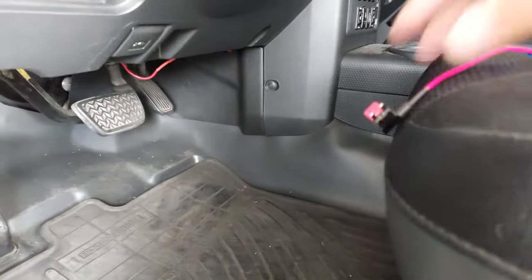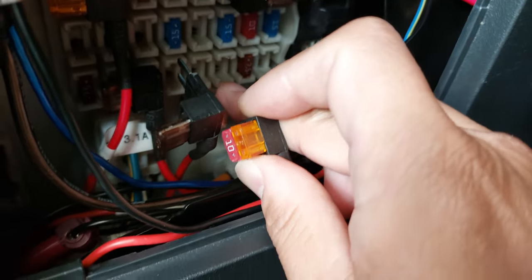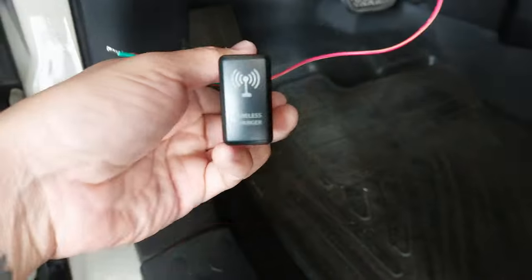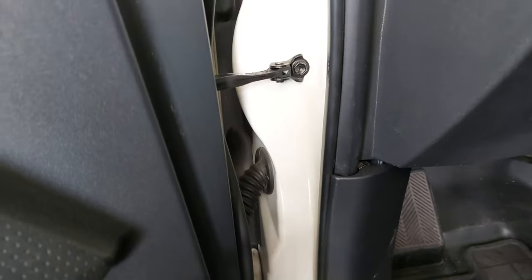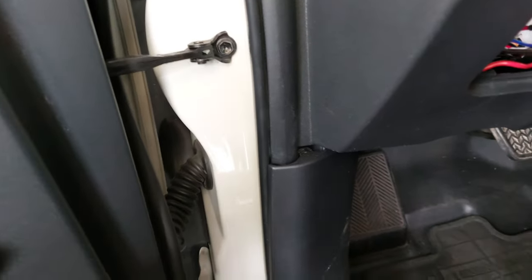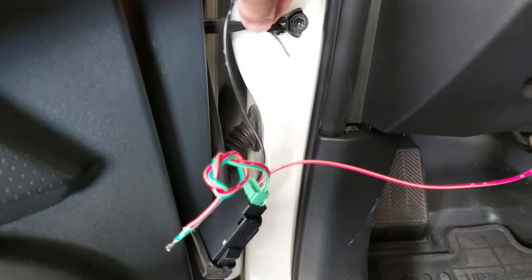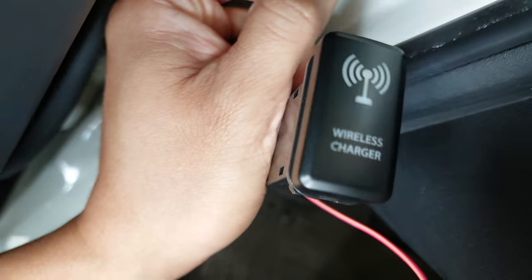Now with our add-a-circuit connected to Red 2, we're going to plug it into the tail light circuit slot — next to that 7.5 ACC — and place it right there. Now all we need to do is ground it to complete the circuit. I typically use this bolt on the side door as my testing spot. Once everything checks out I'll find a more convenient grounding spot, but for now let's touch this black wire to the grounding spot.